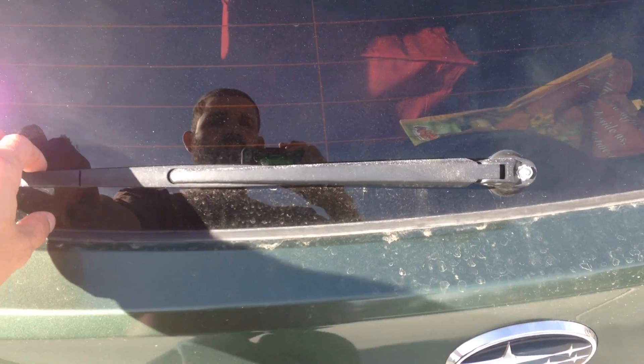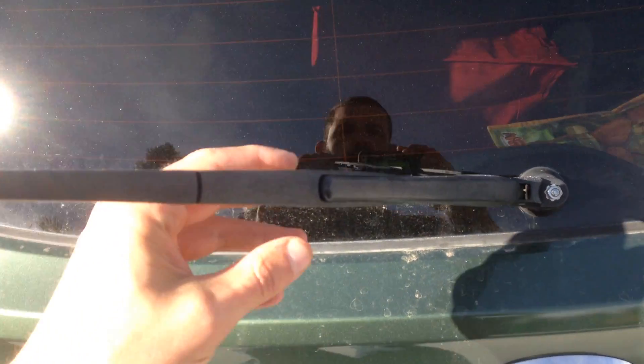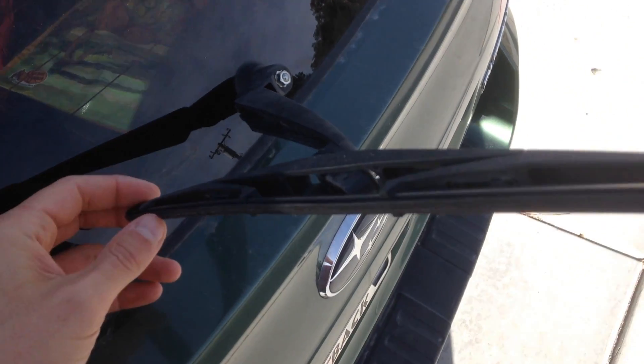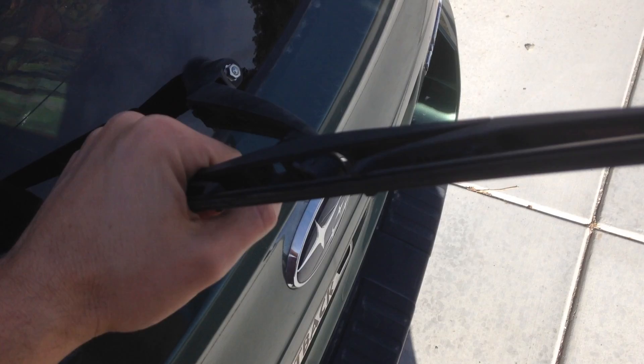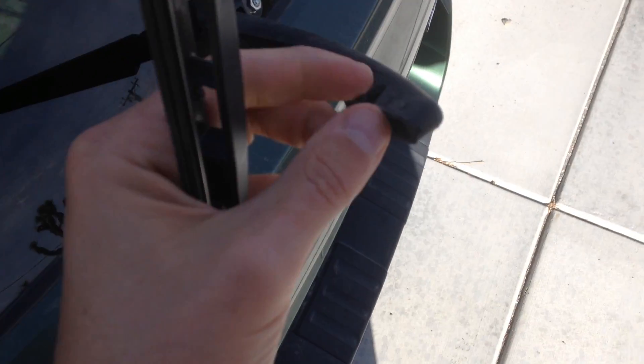It's pretty simple to change once you do have the blade. You just pull the windshield wiper mechanism out and you can see how it swivels back and forth. Grab the part that's closest to the car, pull on it, and it'll rock out of this little mechanism here. You can see it's kind of a half circle shape — a semi-spherical shape.